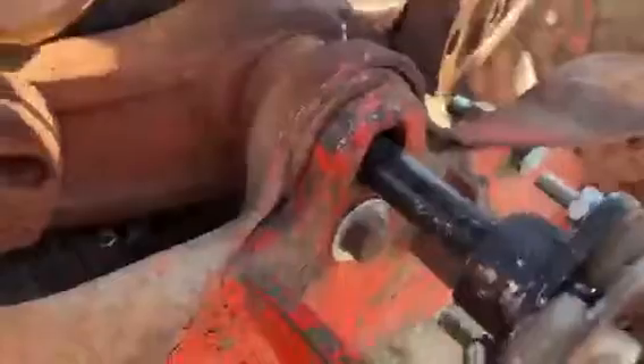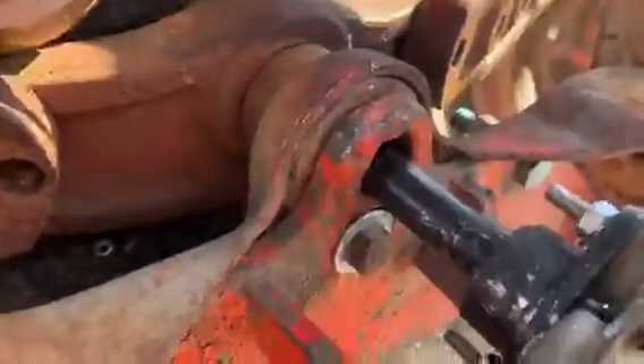From what I've heard, there has to be a piece welded onto this that goes into a kingpin. I've never seen a bracket like that, and this tractor has had a loader before. The kingpin is supposed to be drilled out on later tractors, but I don't think this one needs that. You can put a bottle jack under there to hold it up, mock it up, put in this bolt here — that hole is bigger than it needs to be so you can slide your plate around.